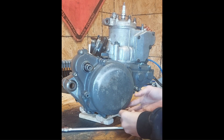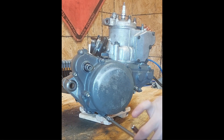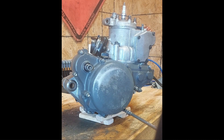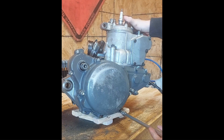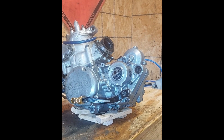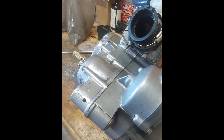All I need to know here is I'm putting the engine case on. Look at that — putting some screws in a hole. The only important thing here: you do not need to tighten these super tight. All it takes is like two foot-pounds — just snug, not tight. That goes for all of the engine bolts and really all the bolts on the bike. I just take two fingers and tighten them down with my little T-handle, and with a wrench I put my hand at the very top and use my thumb to push. That's all you need.